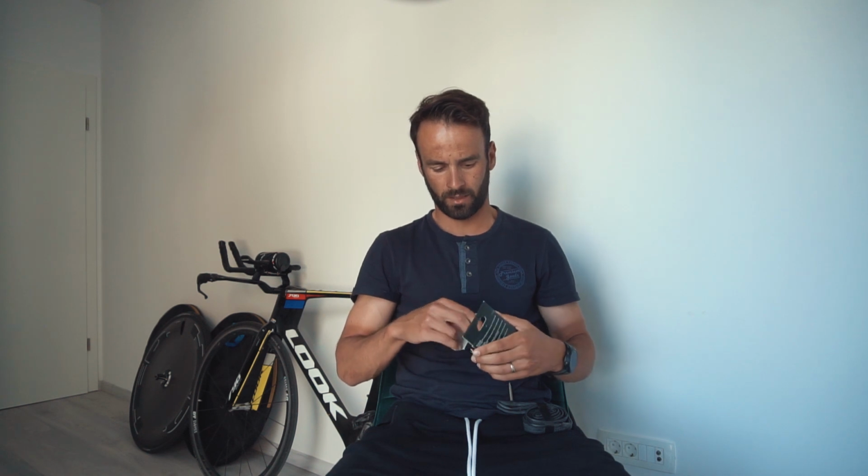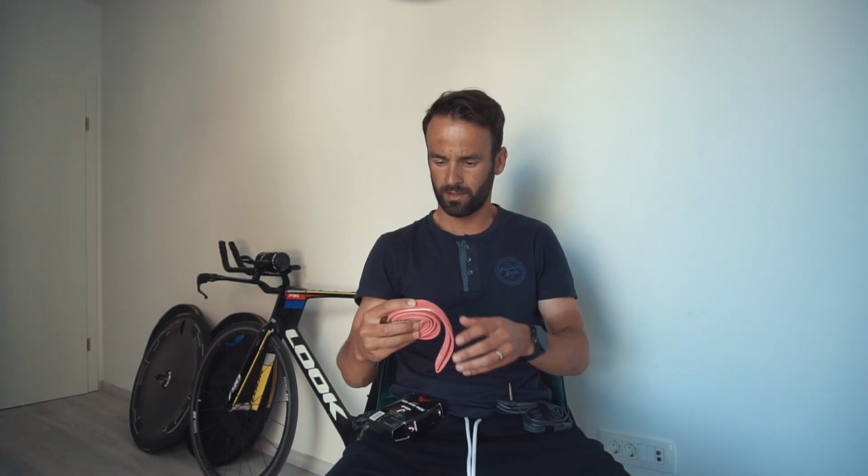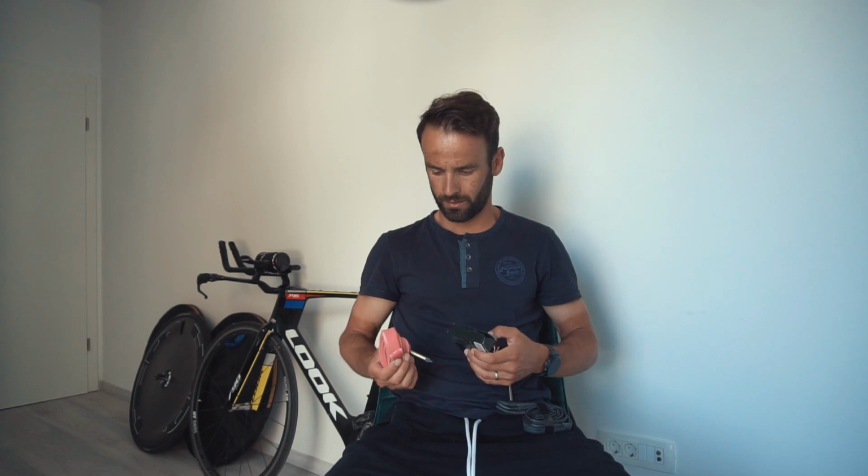So the first part of today's video is about tubes. There are two main types of tubes. You all know about butyl tubes, normal tubes, but there are also latex tubes. And believe it or not, these latex tubes can save you between 7 and 12 watts per wheel set, just by changing the tubes.